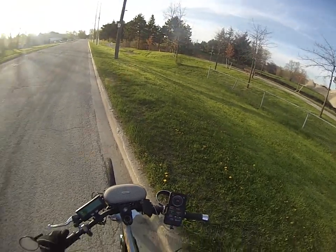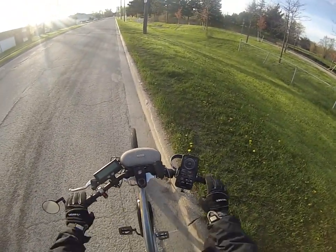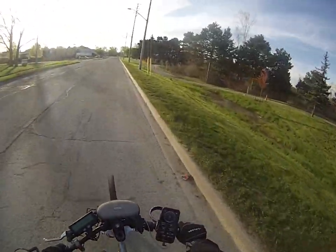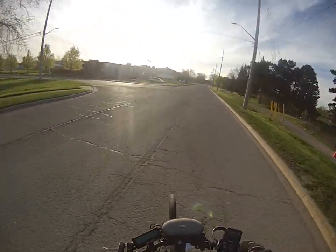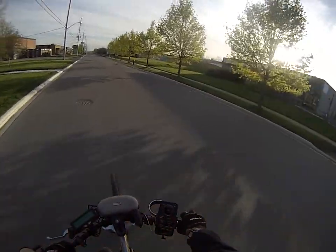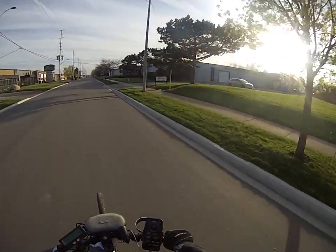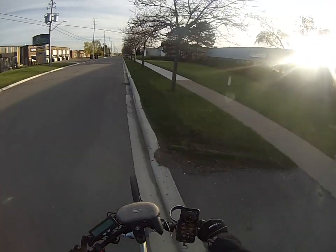200 — confirm, saved it. Back to the app. So I'm going to hold it wide open. I set it at 200 RPM and I'm looking to get up to a street legal speed of 32 kilometers an hour. Right now I'm around 25, so 200 is not enough. It was set at 200 and it was going 206. So let's go back into it. Forward speed — what should I make it? 220. See what that does. Download it to the controller. Back into the program.